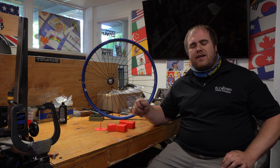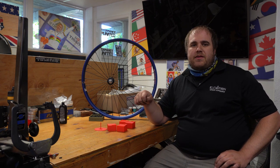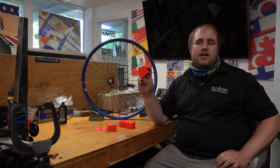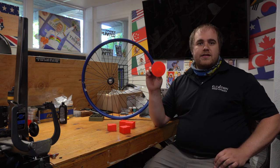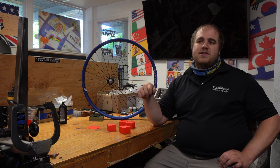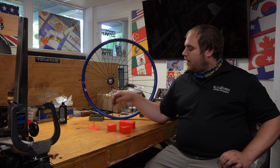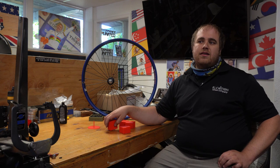I'm not sure if my way was the best or not — it seemed to get the job done, but I definitely had to recut a couple of the spokes because I measured wrong. Some of that's probably just trying to move too quick. These little blocks I printed were actually pretty helpful; they helped hold everything in place and keep the hub off the ground so it was stable while I was figuring out spoke length. This little hub holder was really helpful initially for laying things out, getting positioning right, and getting the first few spokes cut — then after that it was just more annoying than anything so I got rid of it. It took about three to three and a half hours, so definitely a lot longer than a standard wheel build.